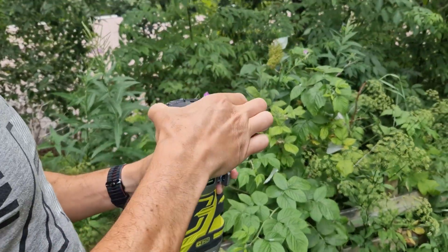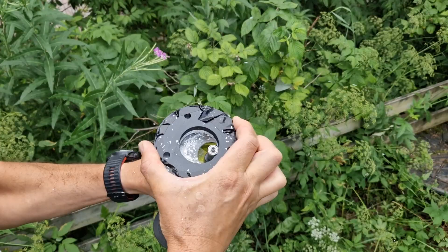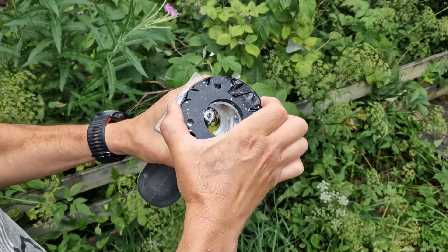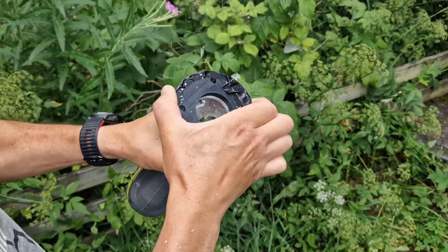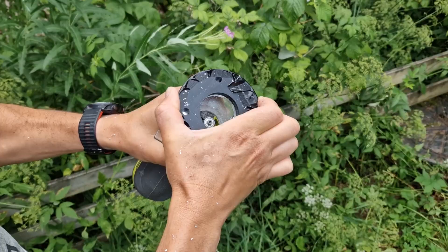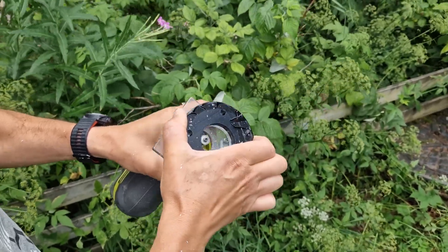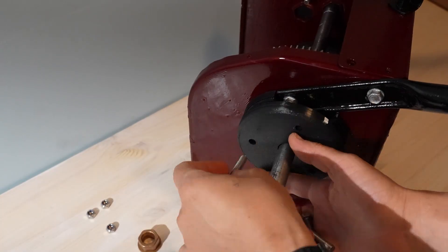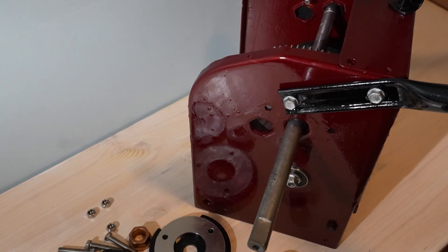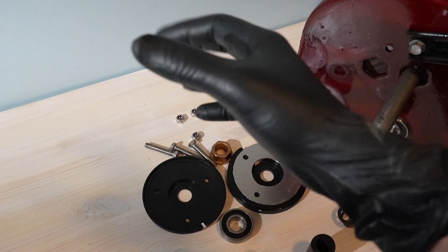To make the aluminum plate, I first cut the outside shape with the router. Once that was done I had four solid discs. I duct taped all four discs together with the 3D printed jig on top, drilled a hole in the middle just big enough for the router bit to get inside, and then followed the jig until the inside hole was perfectly aligned. You can't really clamp it down because the part is too small and the router would just hit the clamp. A CNC would have done the job much better but I was in a hurry. Do not do this — it was really dangerous. I had the whole stack flying out of my hand several times before I finally got it done.